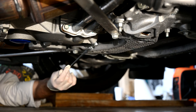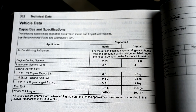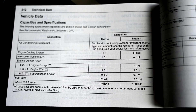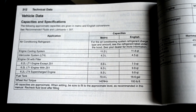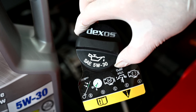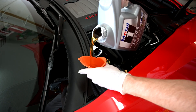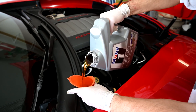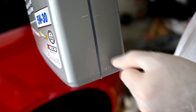Here in the owner's manual, you can see that for this particular engine, the Z51, you fill it with 9.8 quarts. However, due to the peculiarities of this dry sump design, we have to fill it with a little bit less and then test the level before we finalize everything, because we don't want to pour in too much oil. Make sure you're replacing it with 5W-30 oil, or whatever your manufacturer specifies. We'll start by pouring an entire 5-quart jug into the engine. On the second jug, we'll use the indicator and fill until we have just about 4.5 quarts or so.